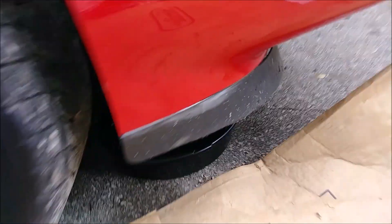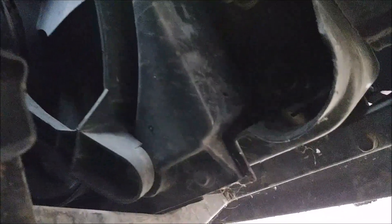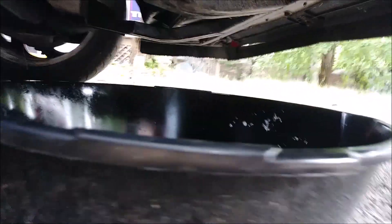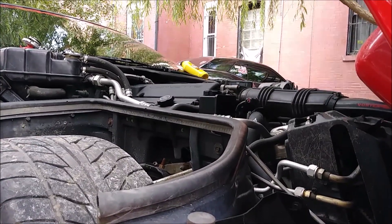Just under the passenger side of the radiator in the back, our petcock is up in there - might be a little too dark for you to see it, but that's where it is. So we're gonna unscrew it, collect what we can in a container, and then while it's doing its thing, go ahead and take that air intake off to gain access to the thermostat.